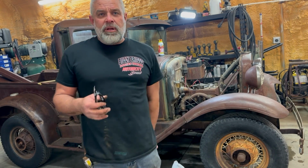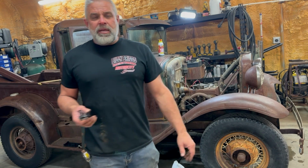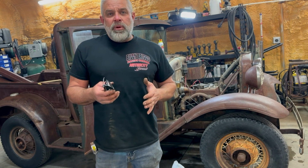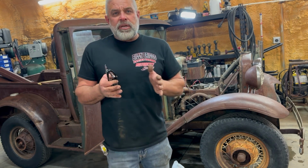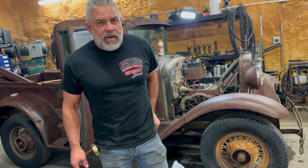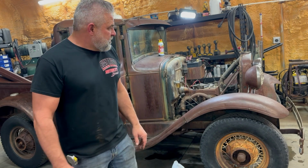I've been through a lot today. I started on this thing this morning and went through the carburetor twice and tried a couple of different things, and started messing around with the spark once I saw that it was getting spark, but only once in a while. It would happen when it would shut off, or when you would quit starting it. It would rock the truck, touch the condenser, and fire right at the very end, so it acted like it wanted to start. Anyway, I pulled the condenser out of one of my other Model A's outside, and dude, it runs great. Fired right up. Sounds like it's going to be a fun one.